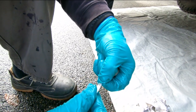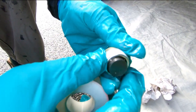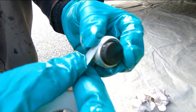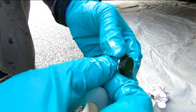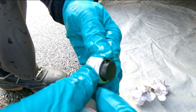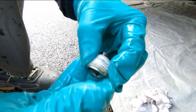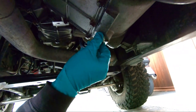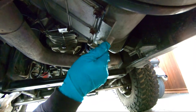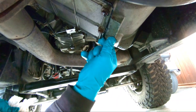Before putting the drain plug back in place, you can add some Teflon tape to seal it correctly. Just as for the gearbox — before we weren't adding this Teflon tape, but drain plugs might sometimes have a minimal leak. That's why now we're adding this Teflon tape on all our plugs. This tape is really cheap and easily findable in any sanitary plumbing shop. You only need to put a little, but enough to seal the thread. Be sure to let the oil flush correctly until the last drops come out. Then wipe the hole and screw back by hand the drain plug. After that, use the torque wrench to finish properly the tightening at 30 Nm.